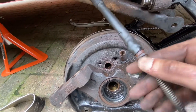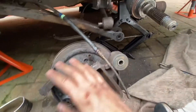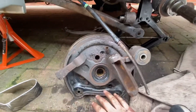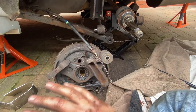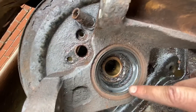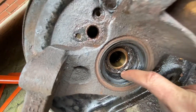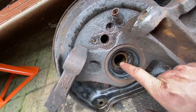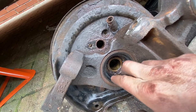What I'm going to do is clean and lubricate all these bits — all the bolts, all the nuts, all the washers — before I put anything back in, just in case I need to remove anything. I don't want to have to go through the whole same process again. Now that this is off, you can see the wheel bearing. Basically you've got one outer seal, one inner seal, and then we can push the hub out. On the other side there's one seal as well and a circlip.